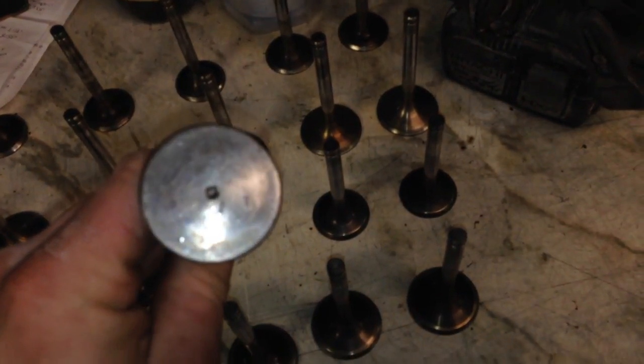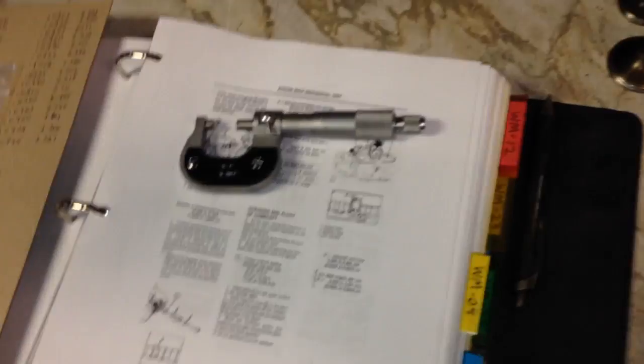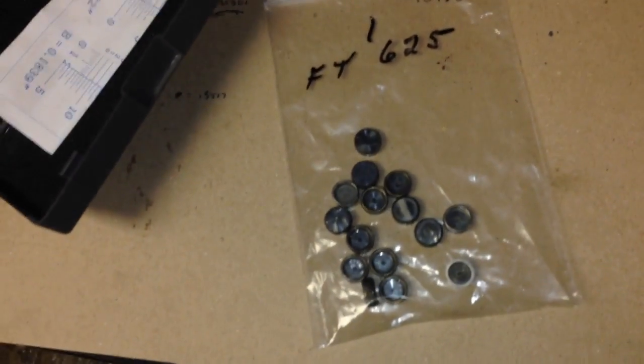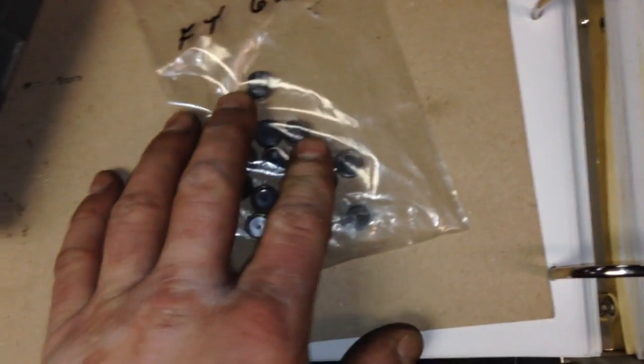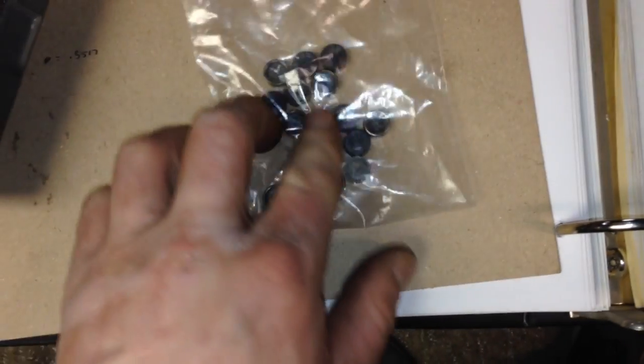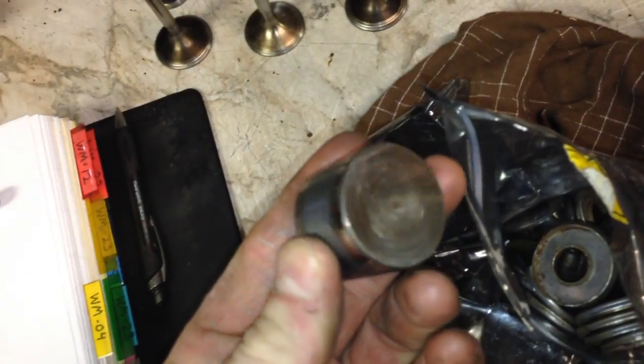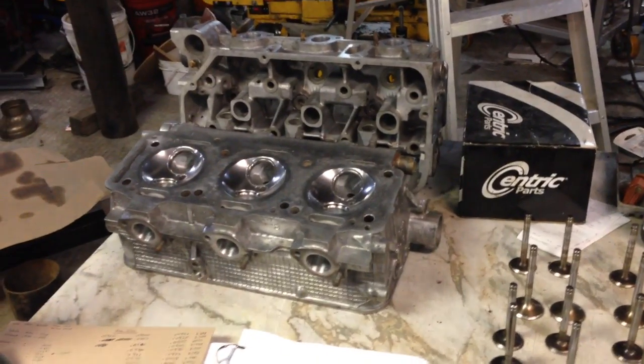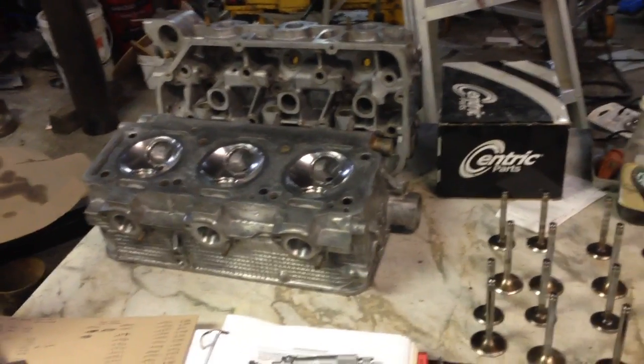With the micrometer I've also taken a whole bunch of shims that I've had laying around and measured them all. Hopefully between all these shims I have the right sizes — though more than likely not, to be honest. To finish the head I may either buy new shims or sand a couple of them down if they're really close to spec. I've got all the valve train and stuff all cleaned up as well — micrometer measuring the wear surfaces to find if they're serviceable. Got a bag of valve springs too. Getting really close to finishing these heads, and then I can begin on the bottom end.